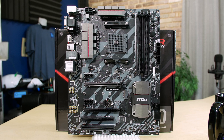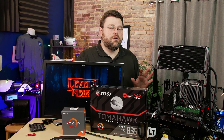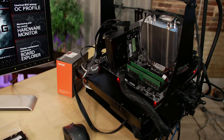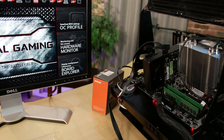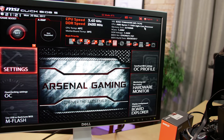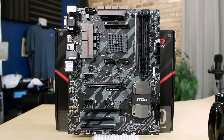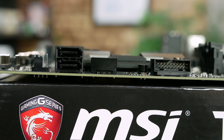Going clockwise around the board — this is a full ATX motherboard. We've got our 8-pin CPU power connector, our first CPU fan connector, and then our four DDR4 DIMM slots. I did test the DDR4 ECC functionality under Linux, and even with ECC memory, Linux reports that the ECC is not enabled — so something about the board or the UEFI does not support error-correcting ECC memory. On the front edge of the motherboard, we've got two more 4-pin fan headers, along with a motherboard connector, and four built-in SATA 6 Gbps ports.